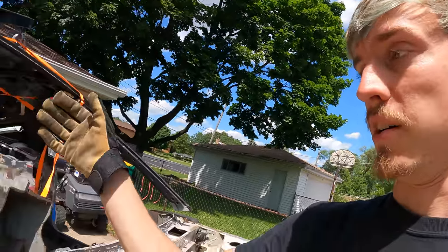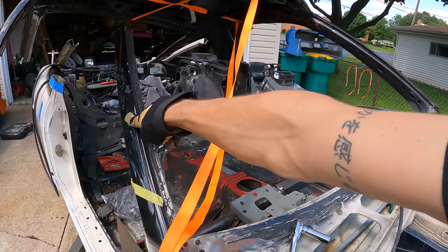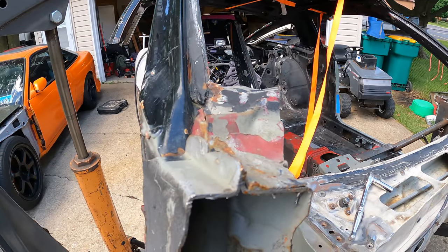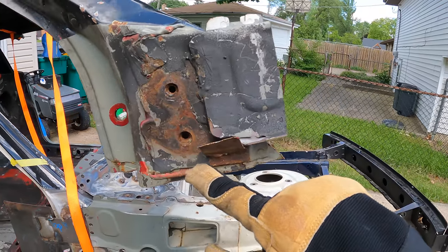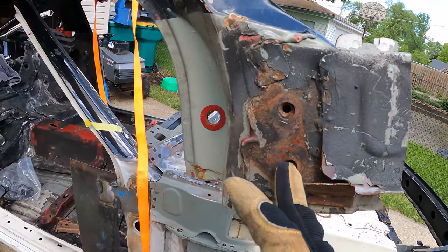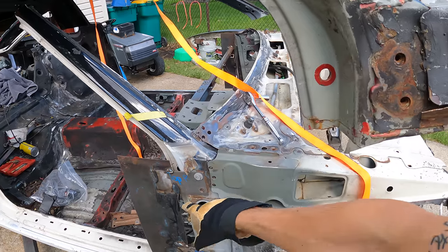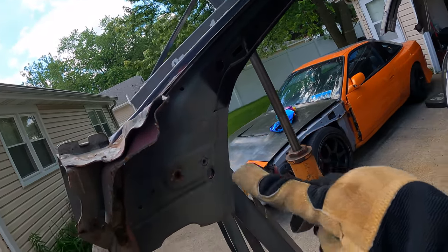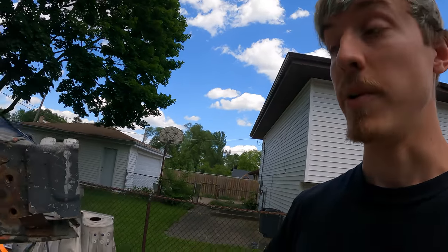When I cut the A-pillar off of the shell, I cut a little extra wide just in case I wanted to use any of this section. Now thinking about it, I do want to — I'm going to drill the spot welds out of this A-pillar on the car. The roof panel actually ends right along this bottom seam and it includes these door bolts, which would be perfect because I have this jig that I can literally bolt the new roof up to, so I know for sure that's in the right spot. I'll also need to drill out some spot welds in the back panel and on the chassis. That's the game plan — prep this roof and hopefully test fit it today.